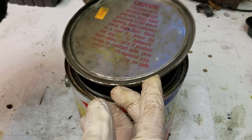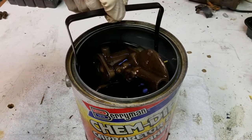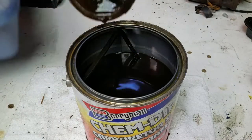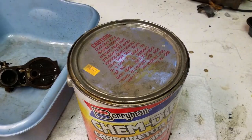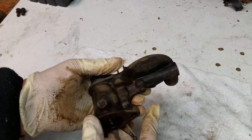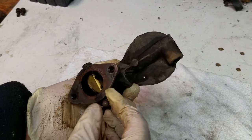Okay, we'll take out the carburetor — it's been about 30 minutes. Here it is after I've cleaned it up and dried it off. There's still a little bit of residue in here; I'm going to have to just blow it out, make sure it's all dry and clean, and make sure the orifices are nice and clean and open.